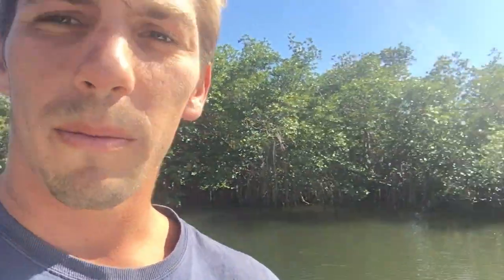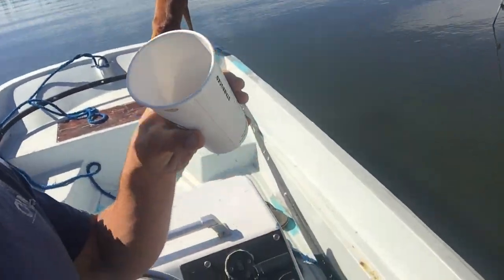Day 28, working on the boat, just trying to get it ready for the Bahamas. I got a little secret for you guys: if you want to do non-skid on your decks, you don't have to pay like 30 bucks for a jar of non-skid abrasive stuff from West Marine, and you don't have to buy special paint. You can just use your regular topside paint — I did it on Tula and it worked awesome. Just get really clean sand from the beach and make sure it's clean and really dry. Me and Jetty just went to the beach and I got a little bit of sand in this cup here.